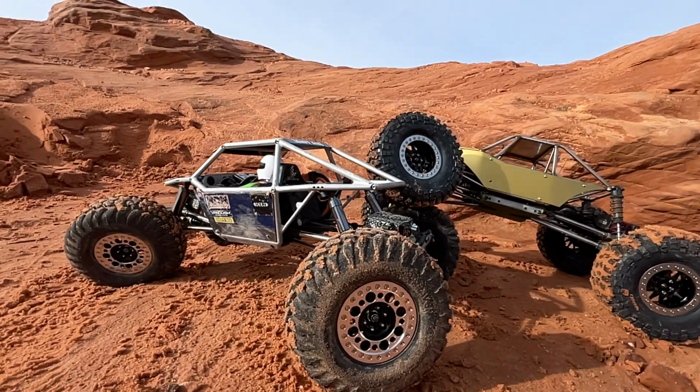Other than that, my stock Spectrum and Amazon servo wielding Capra tube chassis monster was ready to hit the rocks without too much fuss whatsoever. It was really just pop the skid out, pop the shocks off of the Capra chassis, a couple of wire clips to undo, a little bit of double-sided sticky tape to remove, and then from there, it's all about just throwing that flat skid into your new chassis and making room for all of the rest of the goodies.